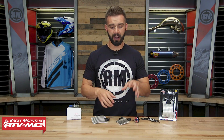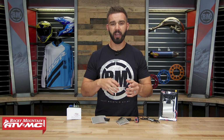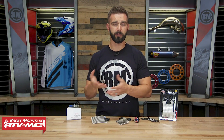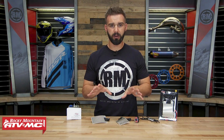Before we cover that, a couple things I do want to mention. So just keep in mind that as far as power, how much these are using, they're going to use 20 watts. So whether your machine has a battery or not, you want to make sure, especially if you are running aftermarket electrical accessories on your machine, you just want to make sure that you have enough juice to power these. If you have a machine that doesn't have a battery, you can splice it into a power source from your stator, but again, just like the machines that have a battery, just make sure that you do have enough power from your stator in order to run these. But once you figure that all out, wiring these up is really simple.